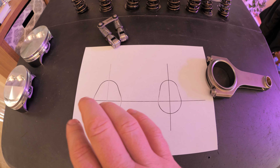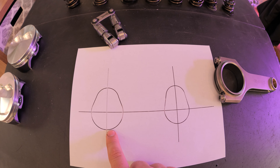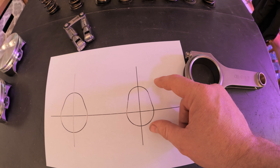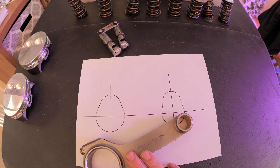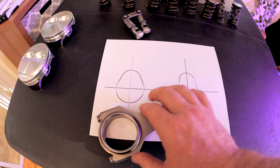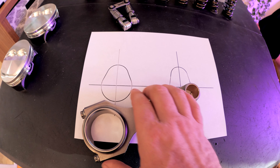Here's a very simple drawing. Pretend the cam is going straight up and down, and this is your cam lobe. We have a standard base circle cam and a small base circle cam. Since I'm running a 400 cubic inch motor, it's the same stroke as a 383 — that's where the 383 gets its stroke from. On a 400 cubic inch motor you can run a standard base circle cam because it has a 3.750-inch stroke, and that is how much real estate the crank takes up inside your block.